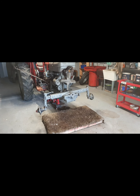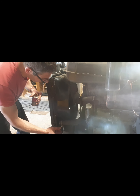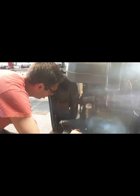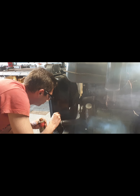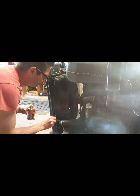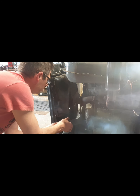The radiator's back on. I like to put a bit of Indian head on the radiator pipes — it just helps seal them up, and it means it's easy to take off again if it has to come off down the road. You'll see I use it a lot in the videos. I've been using it on gaskets and all that — it doesn't affect the water cooling system, oil, or fuel system.